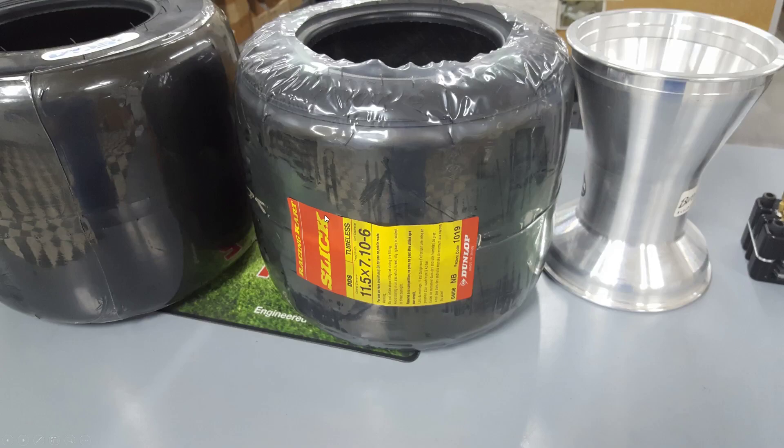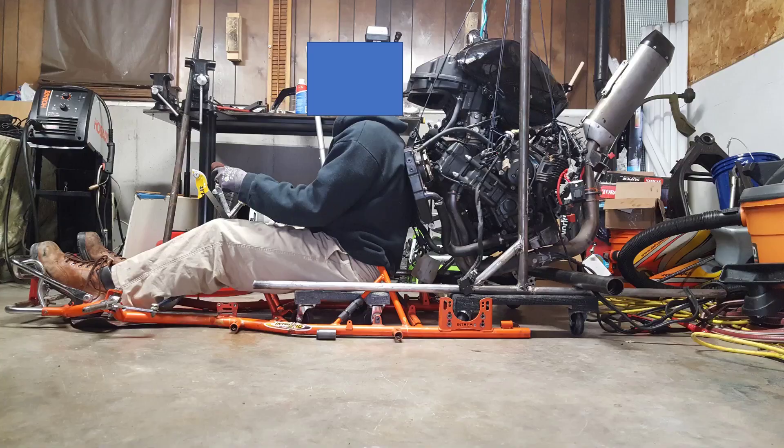For the R1, the stock motorcycle has very tall gearing, but I knew I was going to a much smaller diameter tire, so I tried to get the largest tire I could that was on sale — this ended up being 11.5 inches. I'm sizing up how close I could be to the engine with the frame to see how far I'd need to stretch it. You need clearance between you and the engine, but you don't want the cart to be too long. There also had to be clearance between the axle and the exhaust pipe, since I was not going to reroute it.